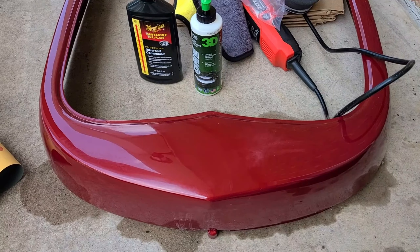Now what I'm going to work on is what compounds with my fancy little three-inch DA sander - what combination of compounds are going to get me back to a polished finish. For this pass I'm actually going to start with the cutting compound and then I have a polishing compound that goes on after. I'm curious to know how much shine I get back just from the cutting compound, taking out any of the scratches left behind by the 2000 grit.